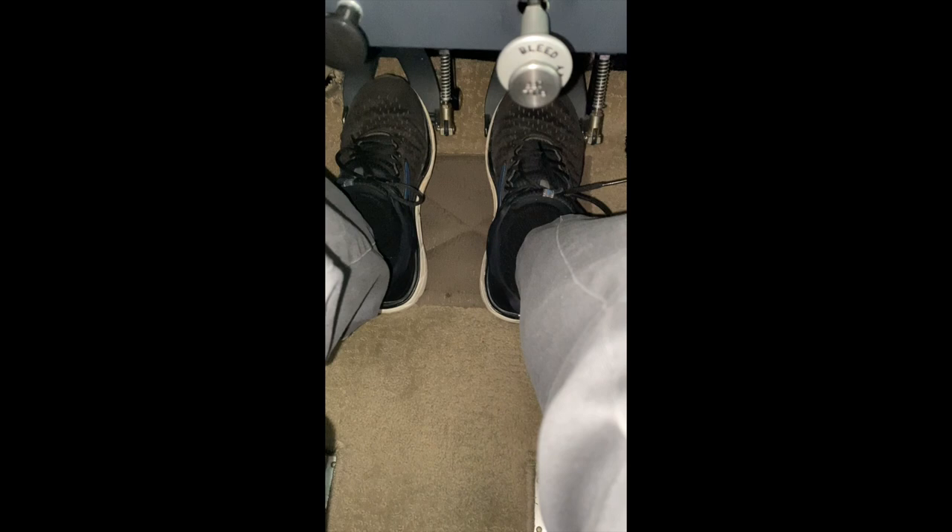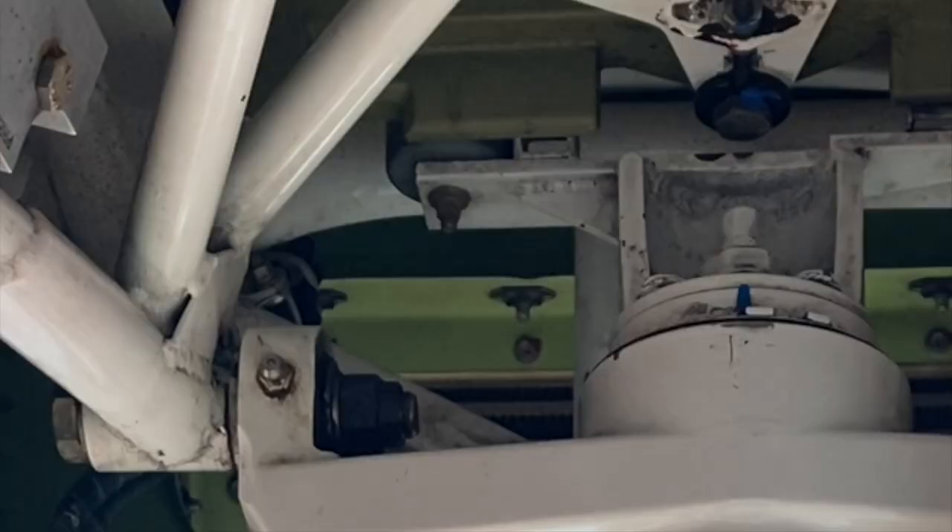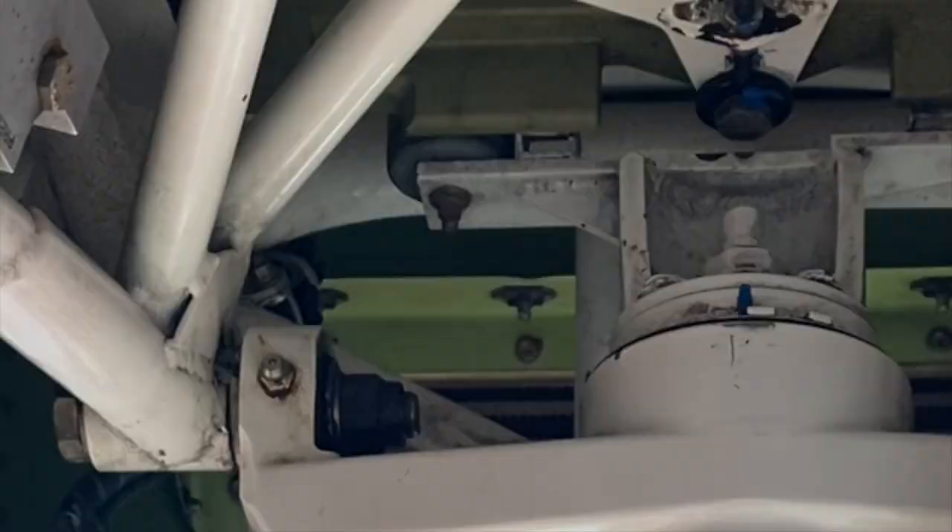The same check can be made with the rudder pedals. Become familiar with the amount of play in the pedals when you're parked — it is the same as moving the rudder. If you have too much play, something is wrong and the gap between the steering horn and the steering arm is too much, and you'll have trouble controlling the plane when it is rolling at high speed. On takeoff, people get into trouble but can get off the ground before running into the grass. On landing, poor steering will put you in the weeds.